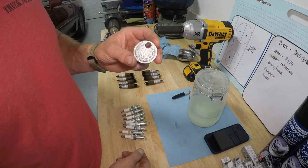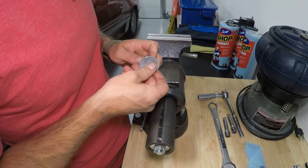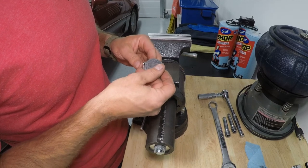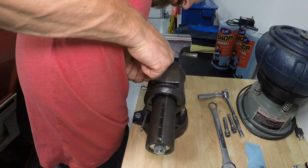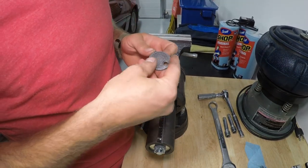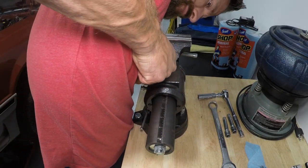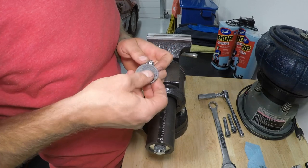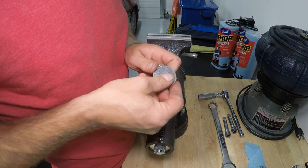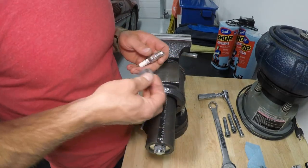I'm going to get these gapped up and get them back in the car. Here's gapping in action — I'm checking the gap on this plug and it ends up being too large, so I'm just going to close that gap in with the flat section on top of my vise. Any hard material you can push on is going to suffice. Then just recheck it again, and if you've got your gap right, move on to the next plug.